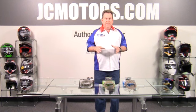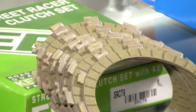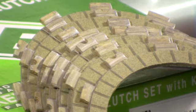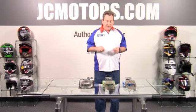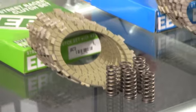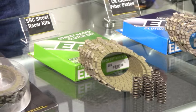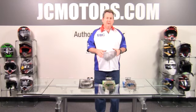We have an upgrade kit for high performance bikes — that's a Kevlar based street racer kit, the SRC kits. Those fiber plates are made of Kevlar and we also include a heavy duty clutch spring kit with each of our SRCs, be it coil springs or the new diaphragm springs in some of the motorcycles. So for an upgrade kit where your steels can just be resurfaced and reused, you have your SRC kit with upgrade Kevlar fibers and the springs included.